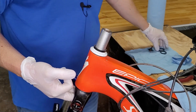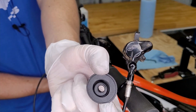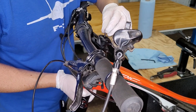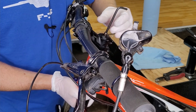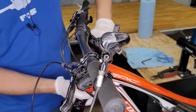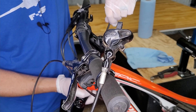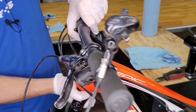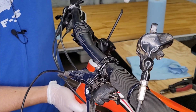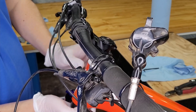Put your height spacers on, then place the handlebars on top. My top cap has an off-center hole cammed with a plus/minus indicator — looking down inside, it lines up best with the plus towards the back. Insert the 5mm Allen key screw in the middle. This screw does not hold the handlebars on; it puts tension — preload — on the top and bottom headset bearings, so don't crank on it. Check that everything looks seated, try rocking the fork in the frame, then turn it back and forth to squeeze out any excess grease. Tighten just a little more using the short end of the key. If you go cranking on it, you can push your bearings through the races.